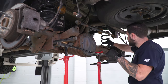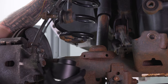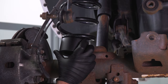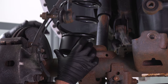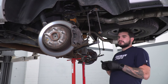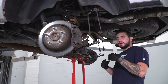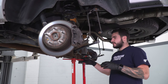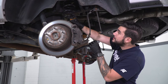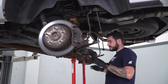The spring is now loose on both driver and passenger sides. Lift up on the spring, pull it out of the perch, and put your spacer at the bottom of it. You may need to pull down on the whole axle assembly — it may make life easier to disconnect the bolt at the top of the brake line if you need more slack. Do the same thing on the other side. Once spacers are in place, jack everything back up into position carefully, making sure the spring is seated completely and properly at the top and on the bottom on both sides simultaneously.